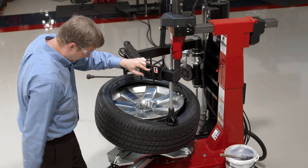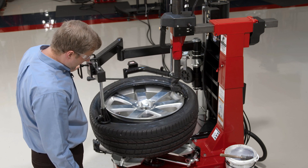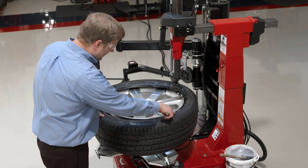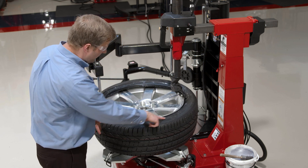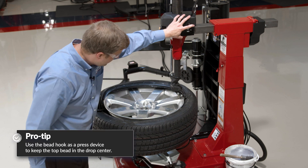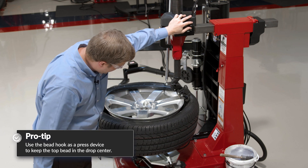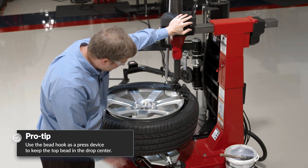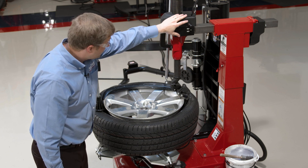So as I'm mounting I've got my tire in the drop center, but I can see I've actually started to mount it — the tire started to sort of mount itself up on this opposite side. So what I can do is actually use my bead hook as sort of a press device, and I can actually press that tire back down into the drop center by partially inserting that hook.